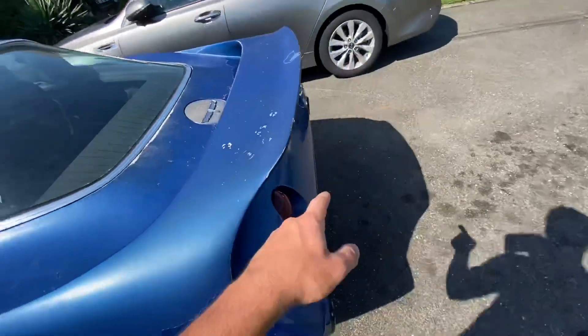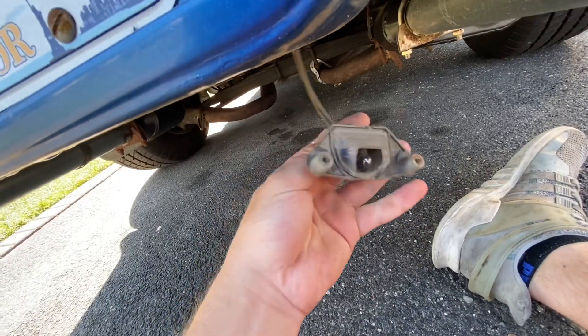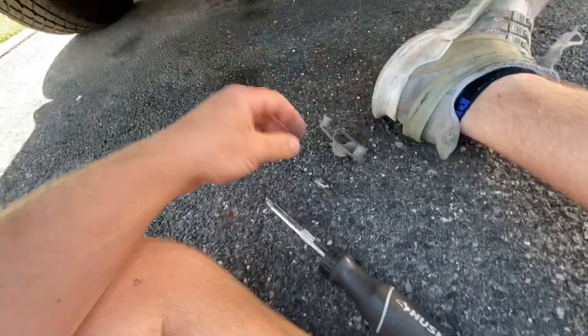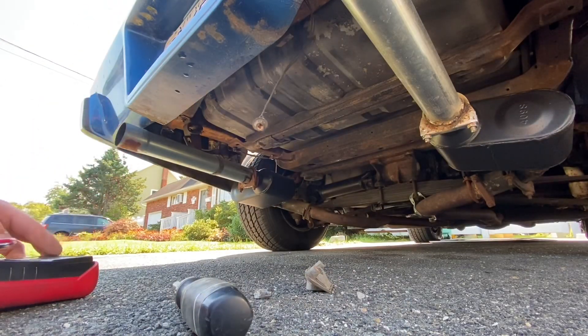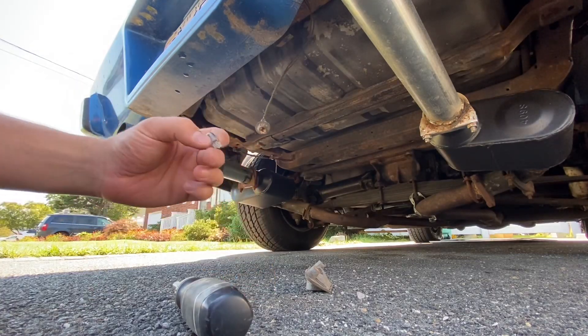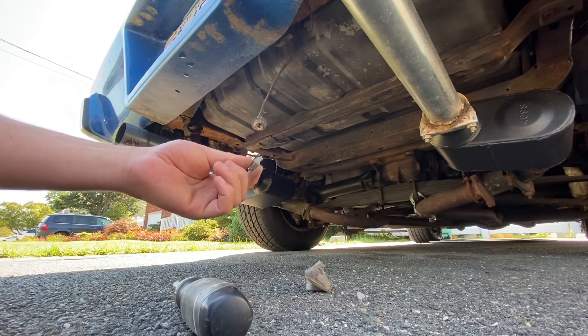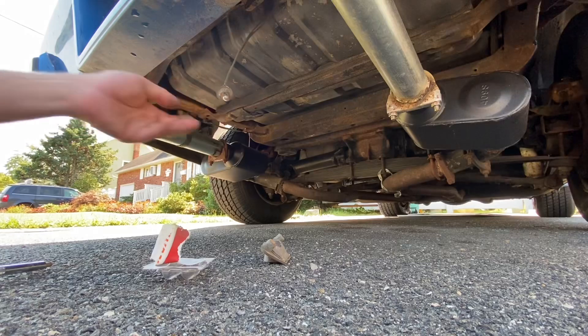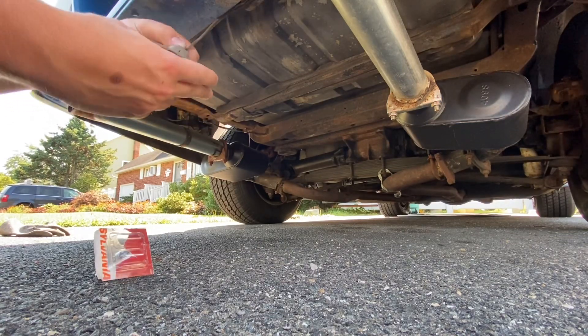Now I want to check out the rear license plate light — I've never actually looked at it before. I'll turn on the headlights and see — yep, does not work. I'm going to pop out these two screws, that should release the bulb housing. Got the two screws out and the whole thing came out. The bulb is definitely shot, but I'll test for power at the circuit first before buying a new one. We do have some power going to the connection. I actually might have the same bulb — I'll check, plug it in, and see if it lights up. It's a match — and we got a license plate light. I'll reinstall it above the license plate and move on.